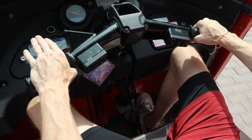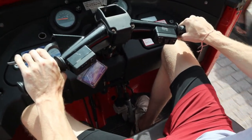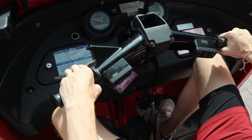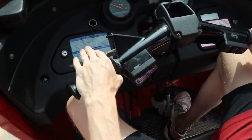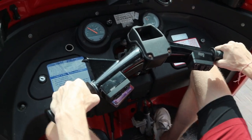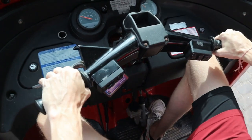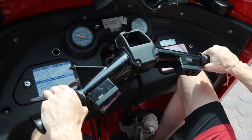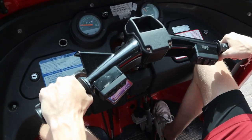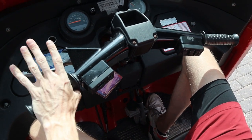There's a big speed bump coming up so clutch in, all the way up to first, release the clutch — nice first biting point. Then down into third, then back up into second — brake, clutch in, pop it up to second, a little bit of gas to match the revs, and away we go. Then we come to a stop — pull the clutch in, brake, wiggle it to find neutral until the green light comes on, and you're done.